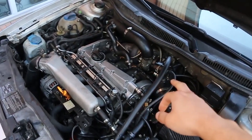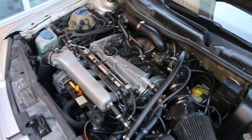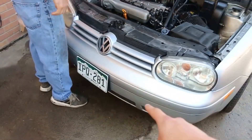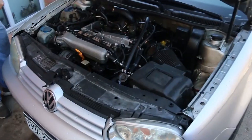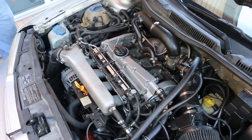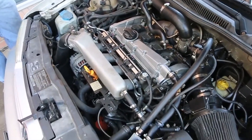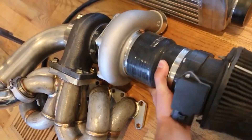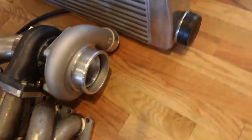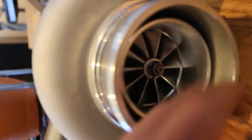But let's say you want more without opening up the motor and strengthening internals. Stage 2. With these mods you should make around 275hp and the motor would happily handle it. In this stage you need an upgraded intake hose and fuel pump upgrade to support the increased power output, then retain all of the parts from stage 1 — bigger turbo, intercooler, downpipe, etc. This is a safe place to chill if you just want a fun daily driver, as these motors are rated to make around 350hp, so 275 should be pretty safe.